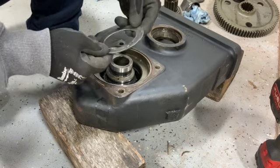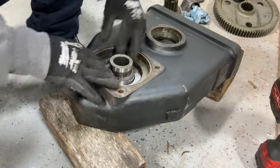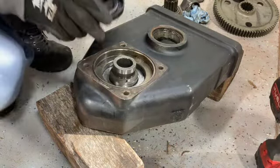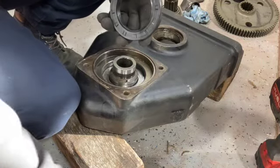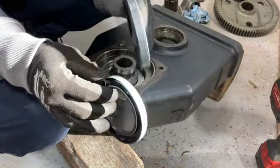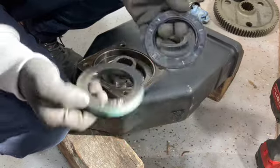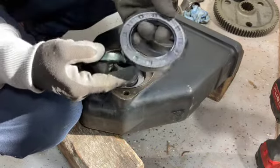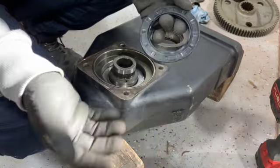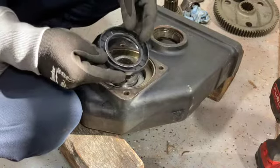That side. Right, that's actually kind of snug in there. All right, here's the new seals. These were, I think, like $12. Now, there's differences. This is a metal outer casing, and this has the silicone or whatever material it is all around it, and it has a lip seal or a dust seal. And this one does not. I don't think it should matter. The dust seal probably just won't be necessary, but all the dimensions are the same, so I'm gonna use it.